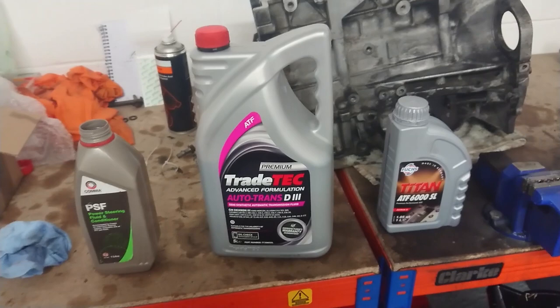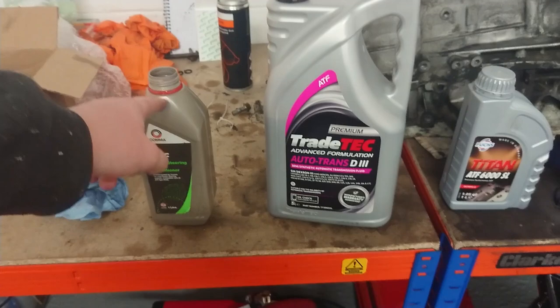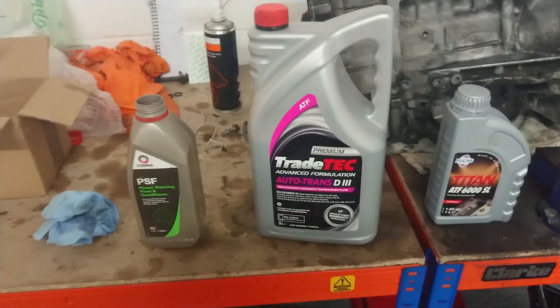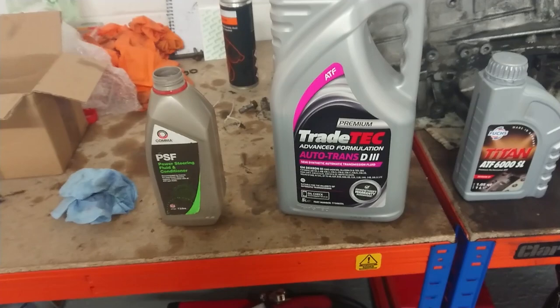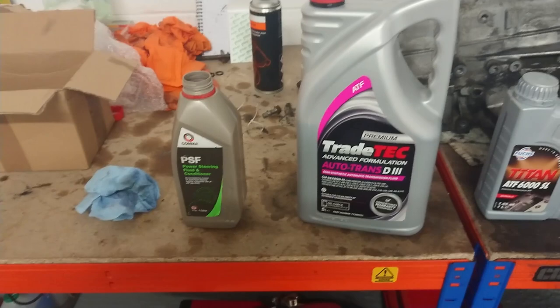I thought I'd have a little discussion about the fluids. For the AYC pump it does make a difference what fluid you use. You can't just use generic automatic transmission or power steering fluid that you'd get in a bottle like this. During my pressure tests I found that the pump wasn't making full pressure due to the viscosity of the oil being out of spec — it was too thin. The pump's not going to make the pressure; the clearances inside are not designed for oil of this thickness, and basically you're just going to get the same fault as always by using the wrong fluid.